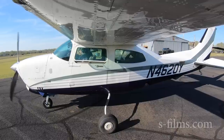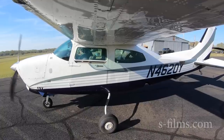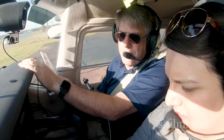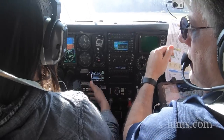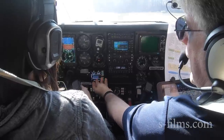Okay, throttle to 1700 RPM. Whoa! You can go a little softer next time, but there you go, you're there. Okay, let that go. Now, hold the white key down until it goes into normalized mode. Okay, you're in. Notice the even blue. Now get your left hand on the keys. Go two clicks over and note the difference. 1690 to 1640, and they all raise the same.